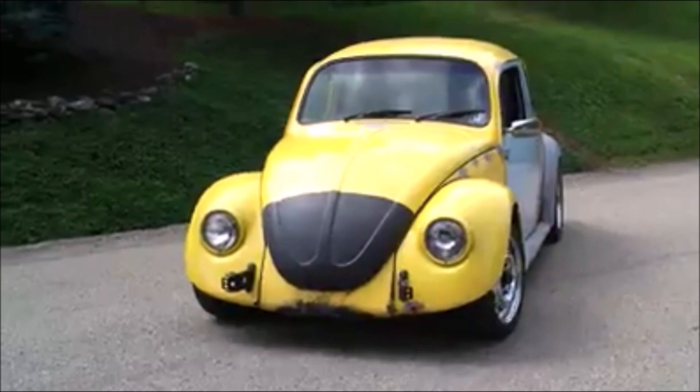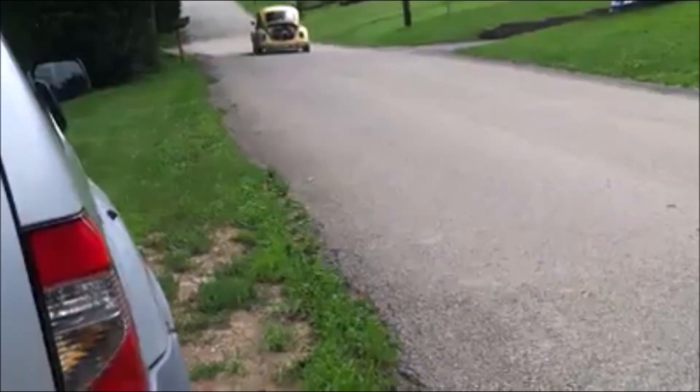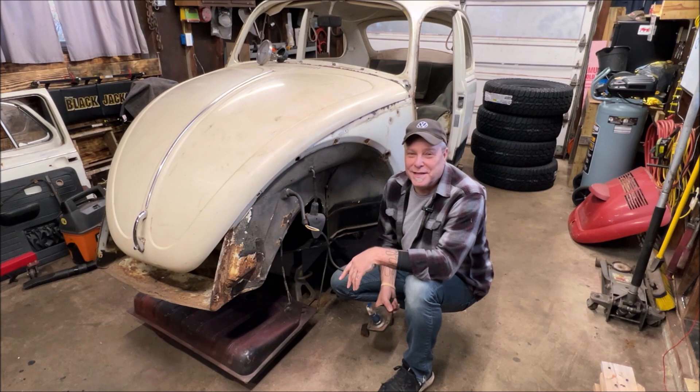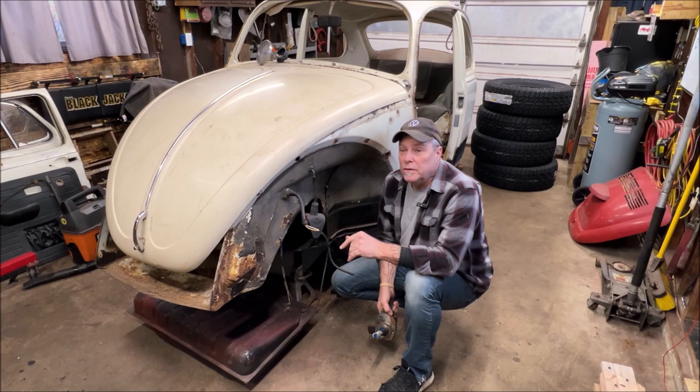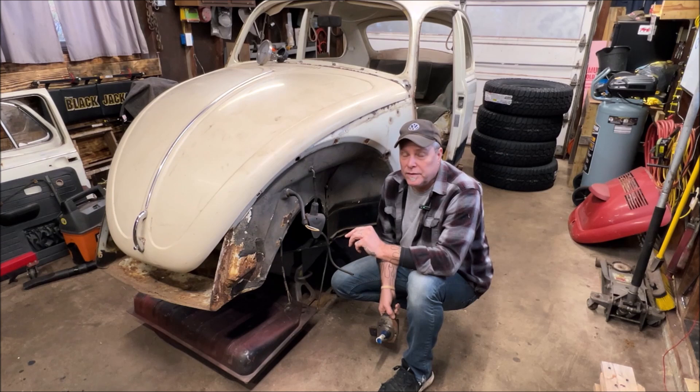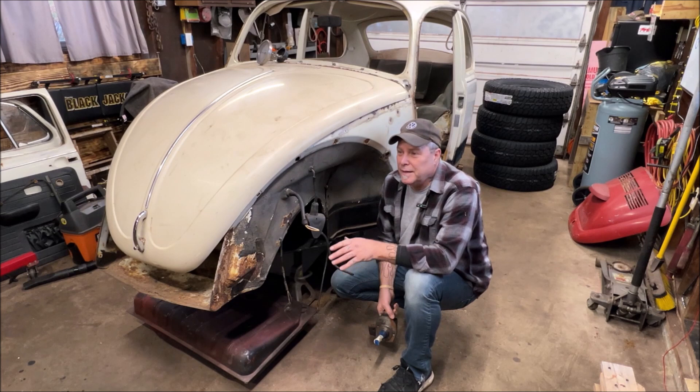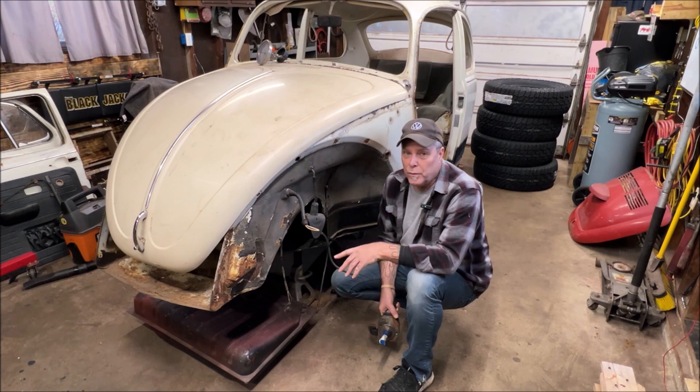On my '72 — that's a cool clip — my son did that real quick when I was leaving one day with no deck lid on. Once you get too far up in, I had 145s on the front of that because the 165s would not fit — they were rubbing. Sometimes you have to get down to a 155 or a 145. Some people use smart car tires, I've heard. The thing I don't like about the 145s is you don't have enough meat — enough tire on the pavement.